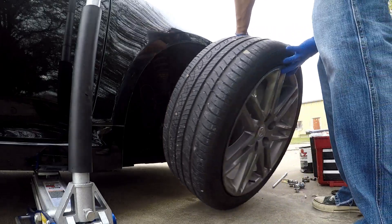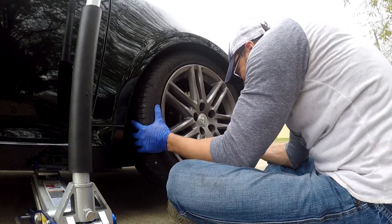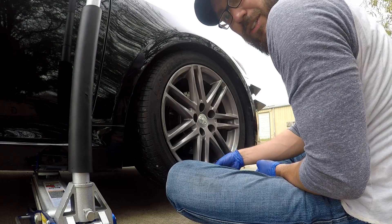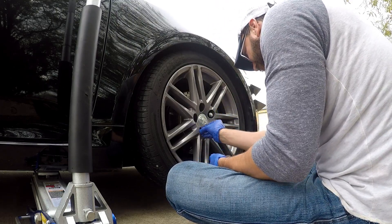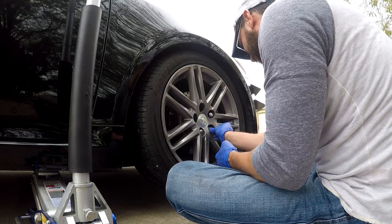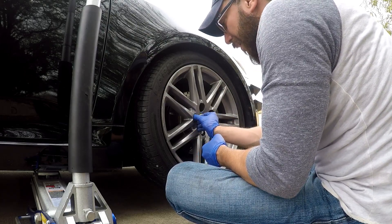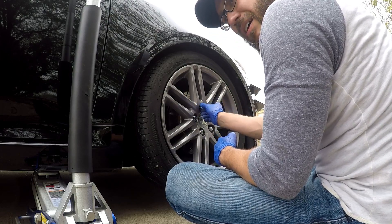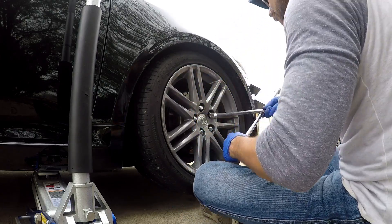They should all be pulled through now. Go ahead and unbolt them and get your tire. I'm putting the stock rim back on since I still need to order new lug nuts. I usually hold the tire with my foot to keep it in place and go through and put on all the lug nuts. When it's time to tighten, go ahead and tighten in a star formation - you don't want to go around in a circle or you won't get the rim properly seated.